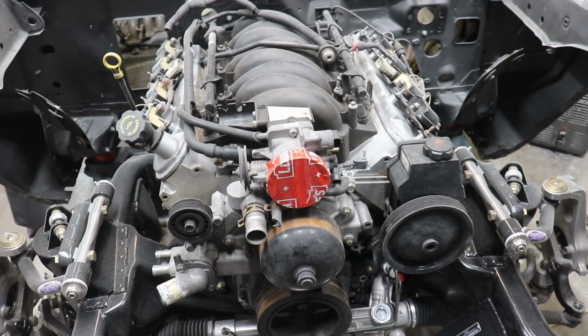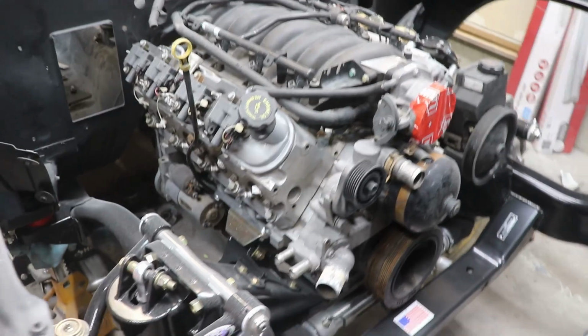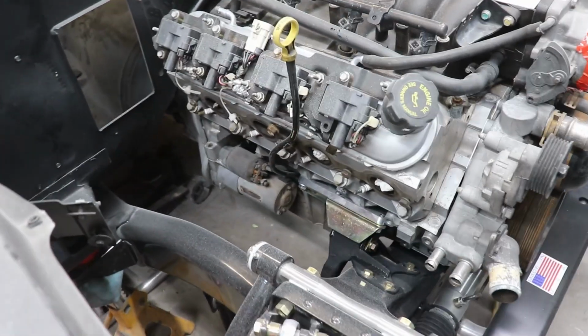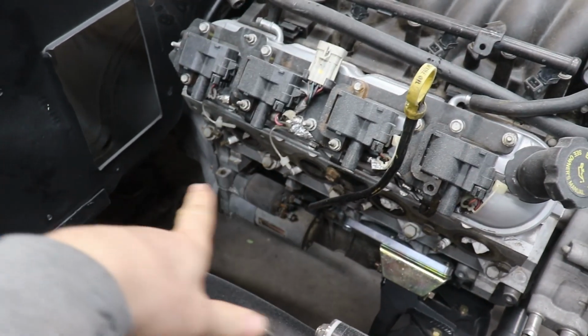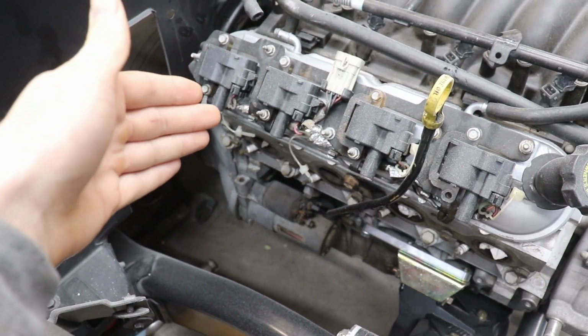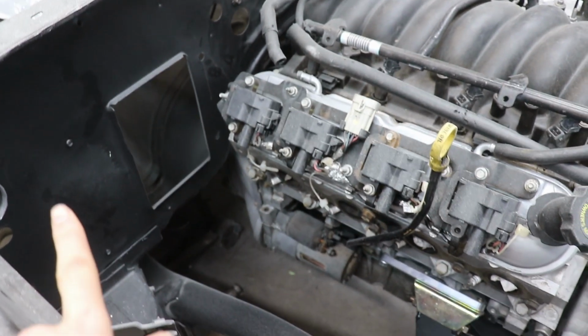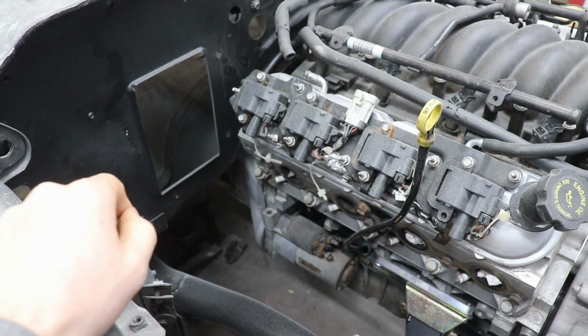So we'll have a top mount alternator, and we took the headers out, but I think the headers will fit for this car. I'm not sure if it's aftermarket or not. I put it in there, and it seems like the collector was kind of angled down, so if you cut the collector off and weld it, you can angle it more towards the body. I think it will fit, so that'll be nice. Make it a little bit cheaper on me.